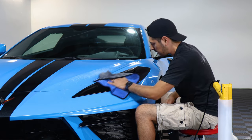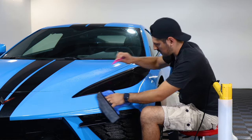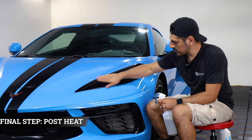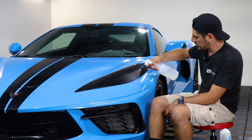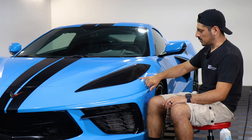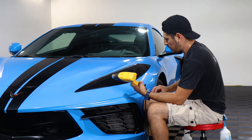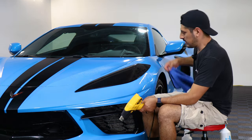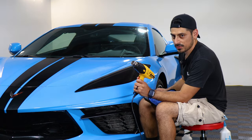Now we're cleaning the headlight to make sure we don't have any water bubbles behind the film. Once we see there are no water bubbles we can move on to the last step: pulse heating the whole film. Apply tack solution all over the headlight, including the edges and anywhere we need to bring down small fingers. With the heat gun, heat the whole headlight to help the adhesive on the film activate faster and prevent it from lifting over time. Use your microfiber towel to absorb any solution still behind the film.